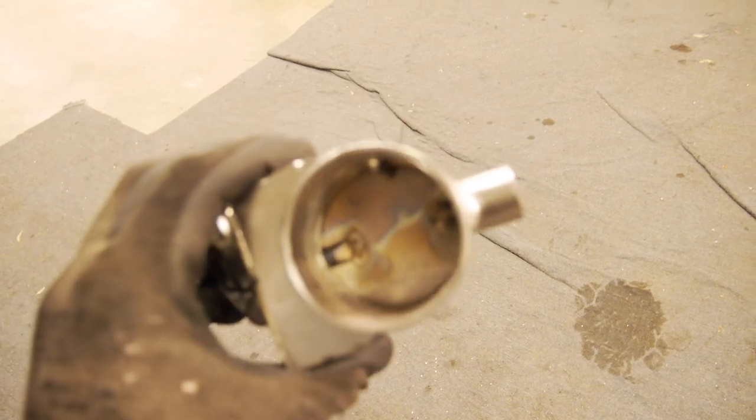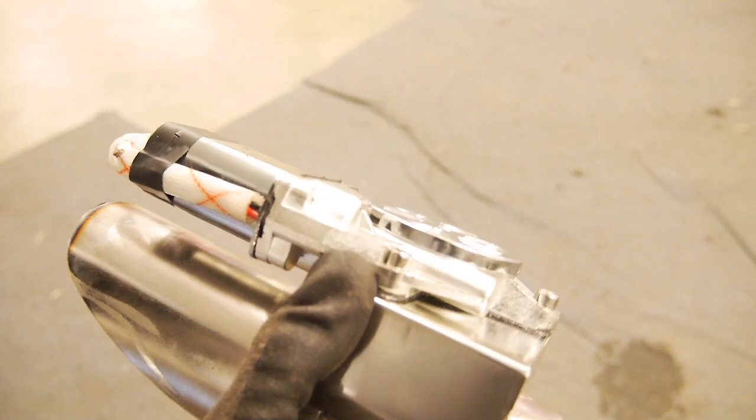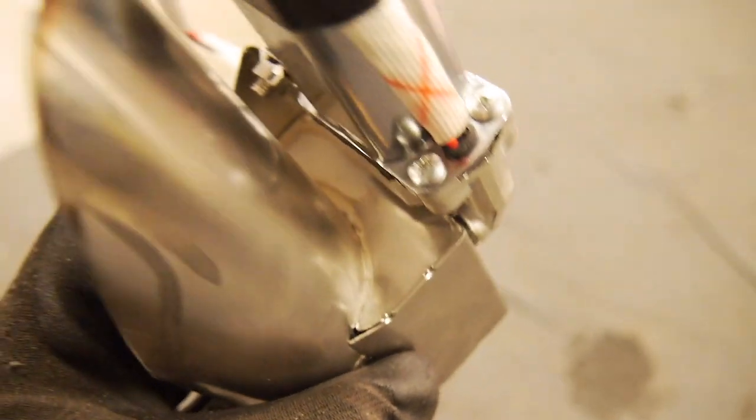And yeah, it actually seems to be a really well built cutout valve. It's only cost me about $100. 2.5 inch, really solid duty. What I like about this is the motor is actually gasketed to this housing here, so it will avoid dirt getting in there. And the whole thing is basically sealed off with a box. So that's really good for off-roading.